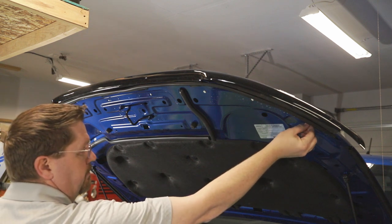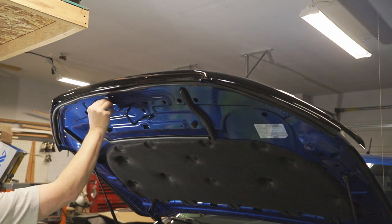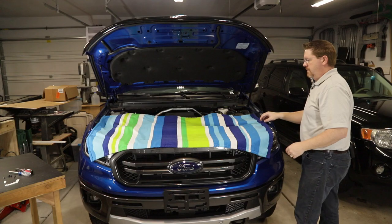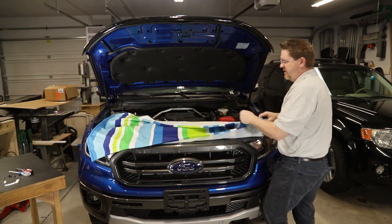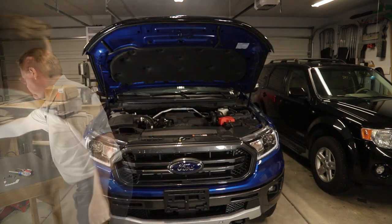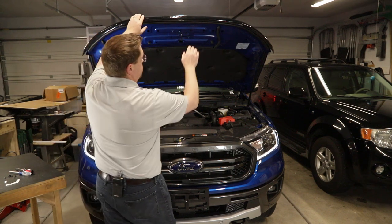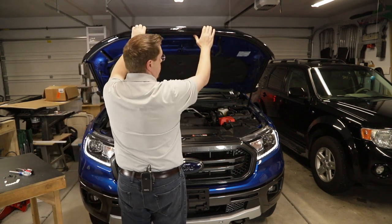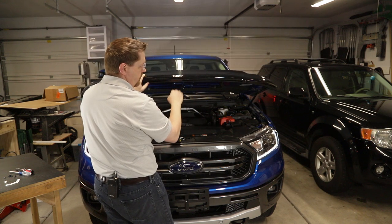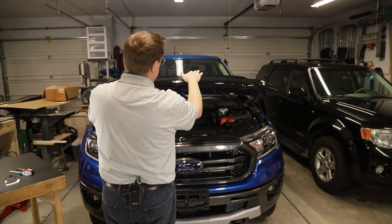You need to do that on all eight of them. Once all those fasteners are in, don't forget to come back and either erase your grease pencil marks or just pull off your little pieces of sticky tack. Then double check — make sure you haven't dropped anything or left anything on your towel or blanket. Take it out of your engine compartment, then finally check your hood compartment and make sure you haven't left anything in there. We're going to close the hood for the first time. You'll find that since you now have that extra thickness of the shield coming underneath your hood, it might be a little bit tight when you close it, so close it pretty firmly and it should have no trouble latching.